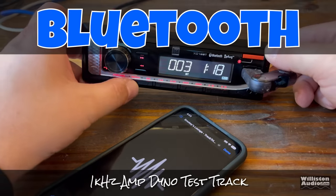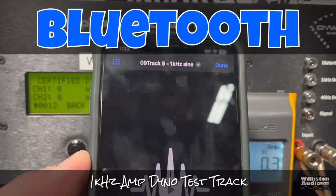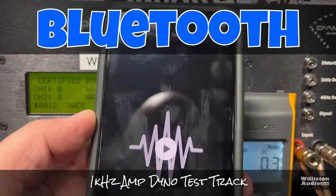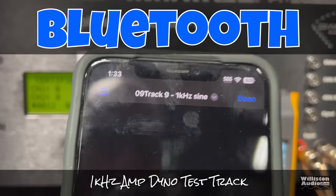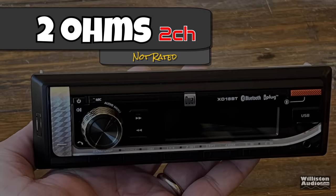So that made us think, what about Bluetooth? Can we get more power using Bluetooth? So we connected the head unit to the iPhone, ran the same track 9, 1 kHz sweep track from the amp dyno test tracks. And let's see what we get here, certified at 4 ohms. And once again, came up shy. We only get 9 watts per channel, at 14.37. So that's unfortunate. We're going to try it at 2 ohms.